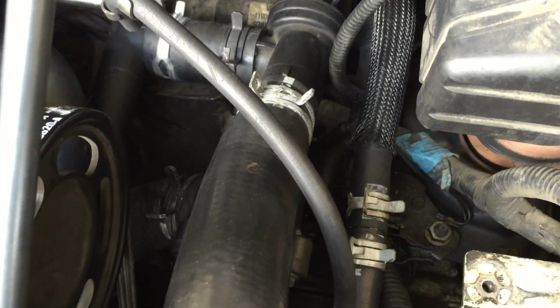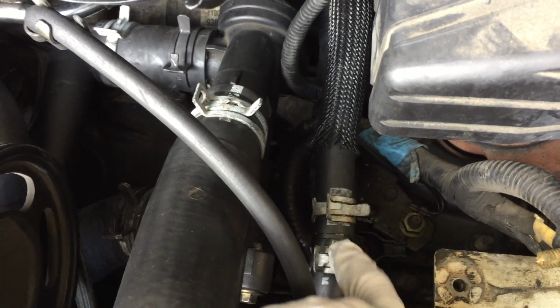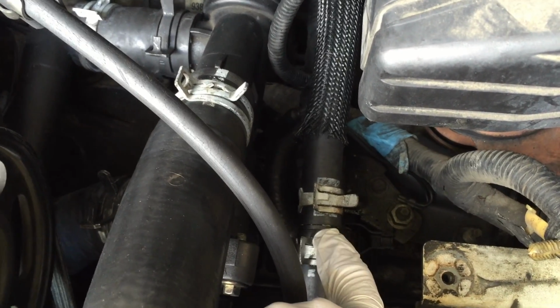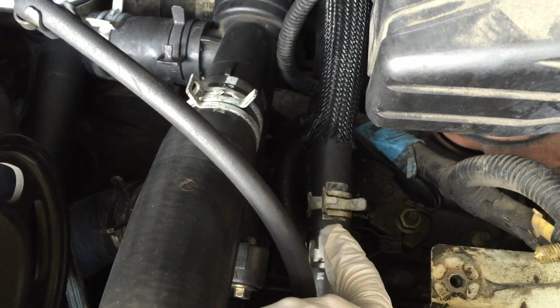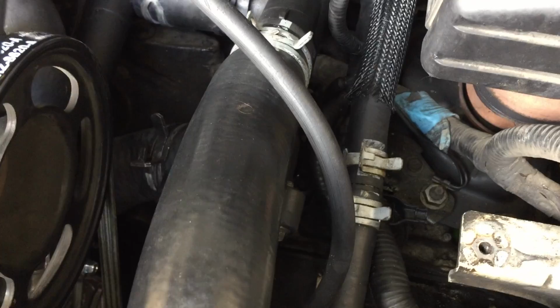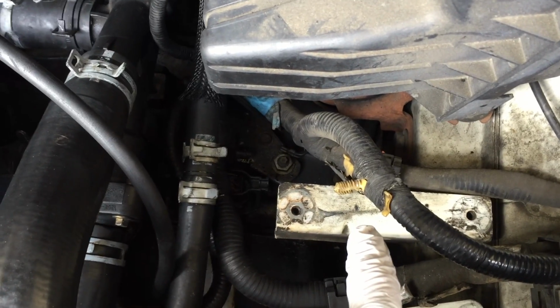And this connection here is a plastic connection. I already changed it like a month ago with all the rest of the hoses. This tends to get brittle when aged, so maybe when you pull this out, it broke. So I suggest also changing this hose here that goes to the heater. What's left is putting the battery bracket, filling up the coolant.